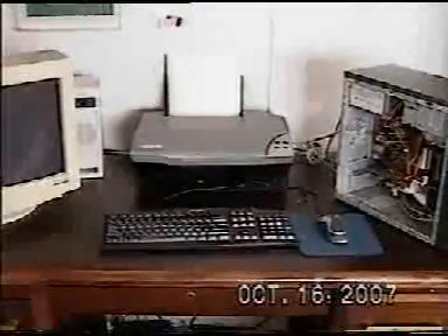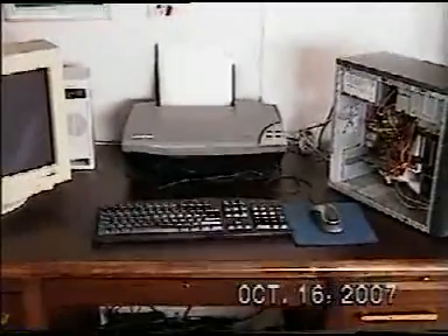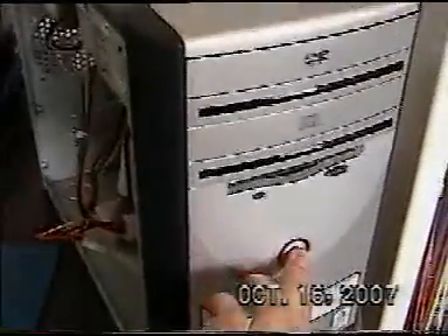Today I would like to show you one of the ways you can tell if your motherboard is bad. A common problem computers have when motherboards start to go bad is that the screen will start up and the computer will be displaying and running just fine, but shortly after a couple of minutes the computer will suddenly restart or shut down.